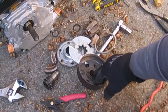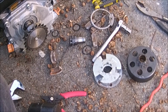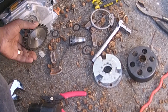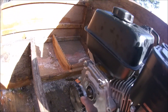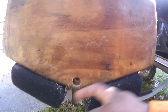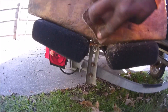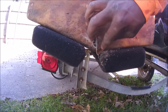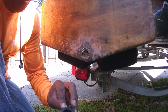I had to take off all of this in order to take off this collar right here. A couple people brought to my attention the possibility of it stalling, but hopefully as long as nothing gets stuck up in the pump housing it shouldn't stall out — I'm assuming it should have enough force to idle through the water. I managed to put on the 22-tooth sprocket here and the 12-tooth sprocket here. We've got our drain plug hole right here. Now I'm going to sand this surface down so the gasket that came with the drain plug has a smooth surface to mount on. I didn't trust just the gasket alone, so that's why I put a bead of JB Weld on it.